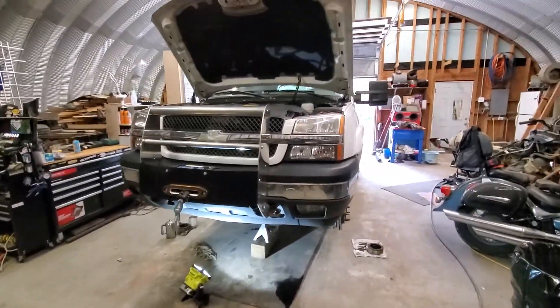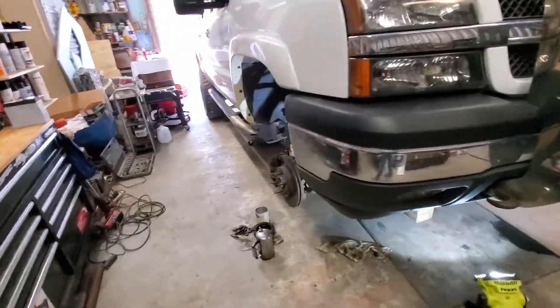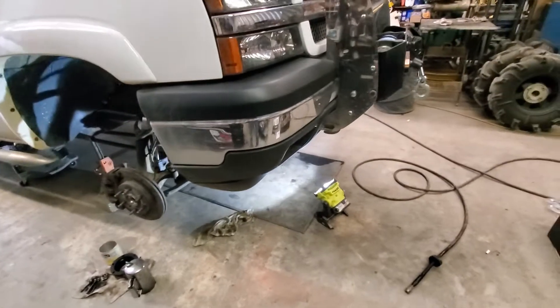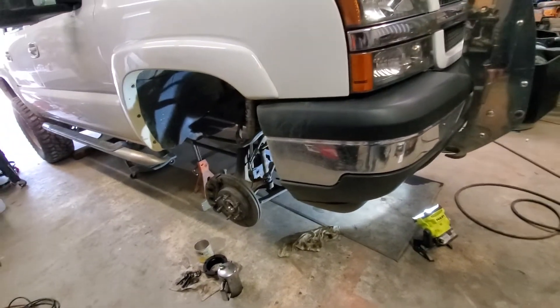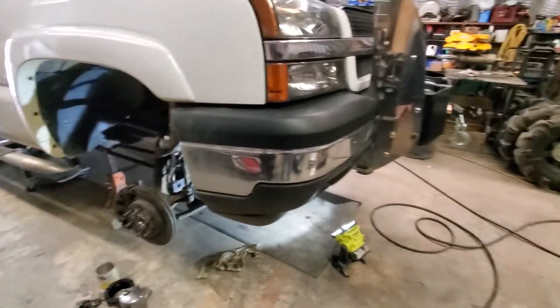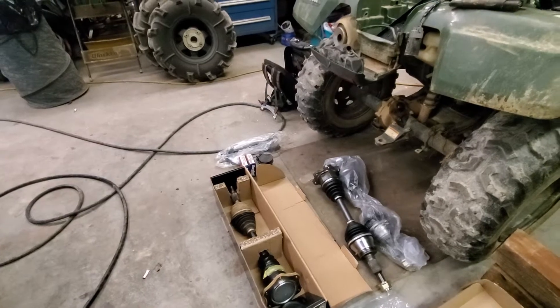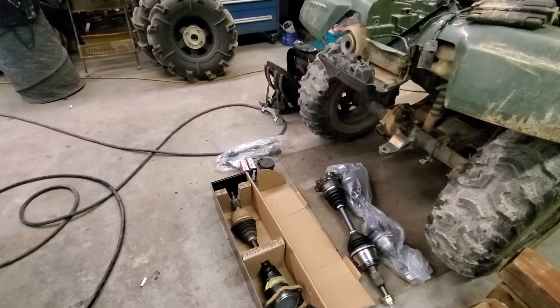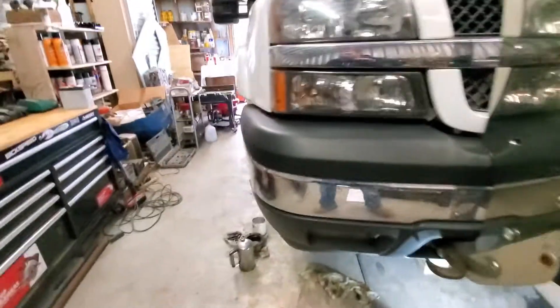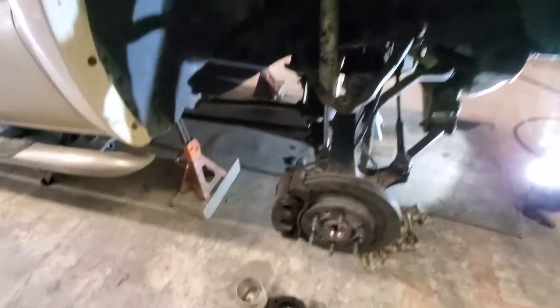Just to keep it short and sweet — I just did the brakes last month or two ago and noticed my CV axle boot was about to rip; it had a slice where the creases were. It seems every two years these Duralast CVs — here's the part number — the boots on the inner cup always go out. I don't know if it's the material of the boot or if it's from the extended length, stretching out too far and putting excessive wear on the rubber.